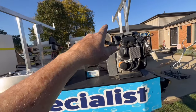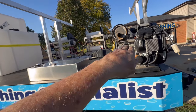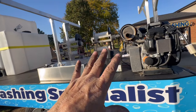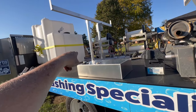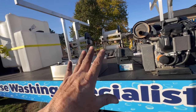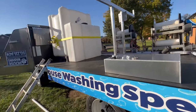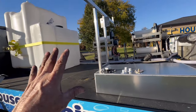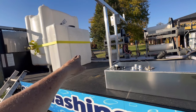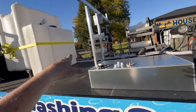Why do I have a separate battery for the 10-gallon-a-minute machine? Well, for one, it's more wire I'd have to run to that primary battery. However, the main reason is redundancy — if something were to happen to one battery, I have a backup. In those areas where if something happens you're toast, it's just good to have redundancy. In actuality, on this rig I already have a second battery since my truck battery is immediately adjacent to my primary battery, so I actually have three batteries.